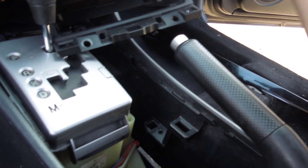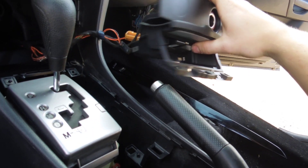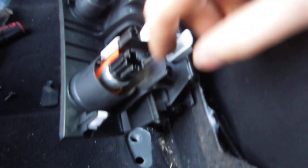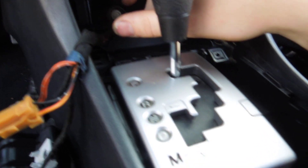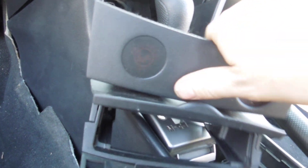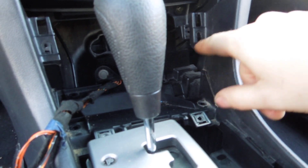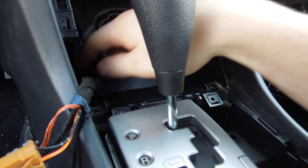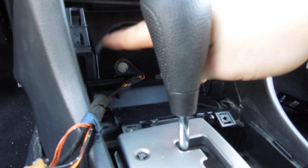You'll have your cigarette lighters in here. Unbolt the two Phillips head screws, pull it out from around the gear shift, and take the light bulbs out using a small flat blade. After that, carefully work on popping the corners — don't put too much pressure on it, you don't want to break your lid off. There are Phillips screws here, here, and here, plus a couple in the back that require a stubby screwdriver — four total in the back and additional ones at the front.